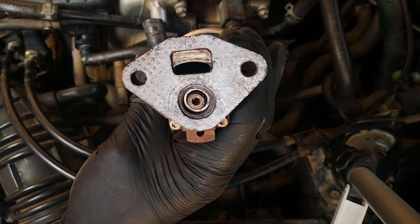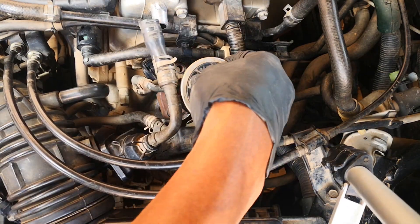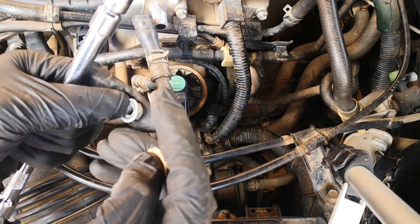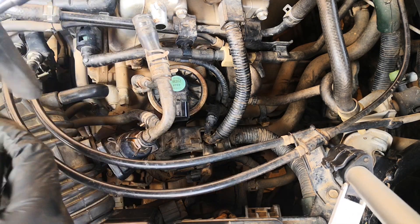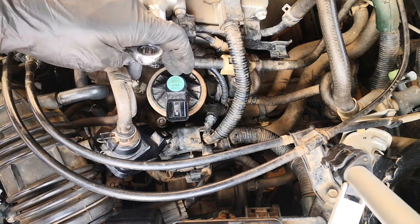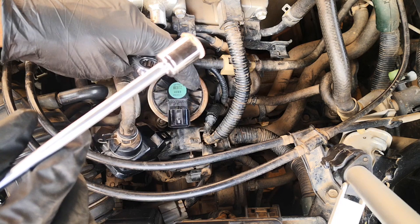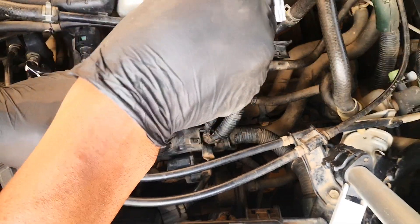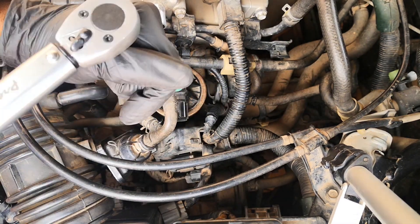Now that we have this clean, we'll go ahead to reinstall. This pointy end is facing towards the rear of the engine. Reinstall the bolts — small trick to get the bolt to stay: put a piece of paper by the side and stick it in, that way it stays. As you thread in one of the bolts don't thread it all the way, because you're going to be working at an angle and it's going to be difficult to screw on the bolts — so you want that level of flexibility before going for the other bolt.